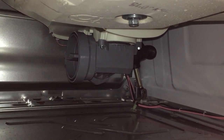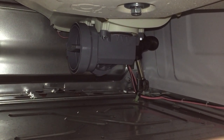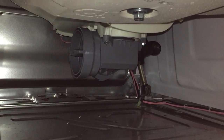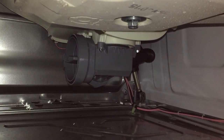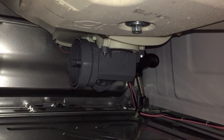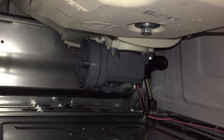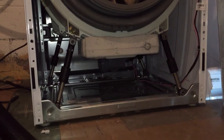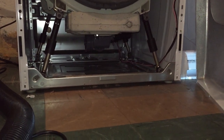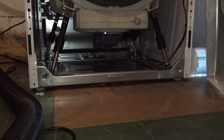I'm going to have the shop vac running as I open that and hopefully catch most, if not everything. If you don't have a wet dry shop vac, I think you can use a carpet cleaner. I said some of this on the video on the handy cam, but I'm not sure where it cut off. A carpet cleaner should be able to suck up the liquid just as well as this shop vac. If you have a wet dry shop vac, make sure you convert it to wet function by taking out the paper filter. Some of them you need to put a foam filter in there. Some of them you just take the paper filter out.